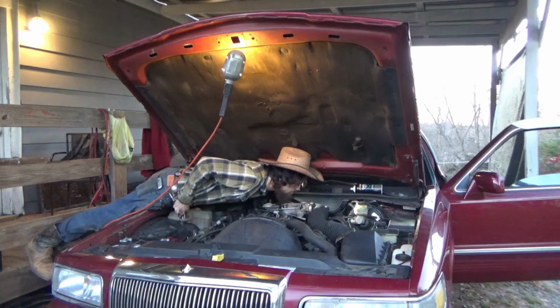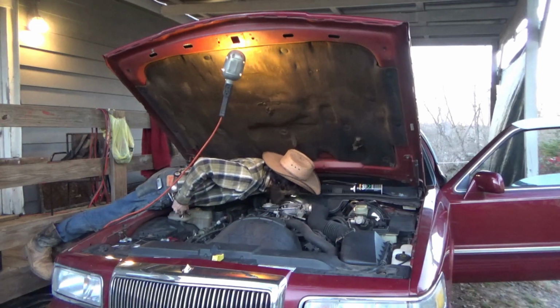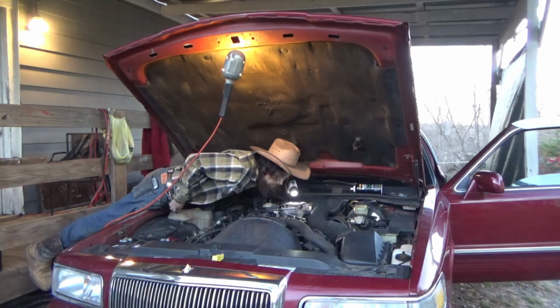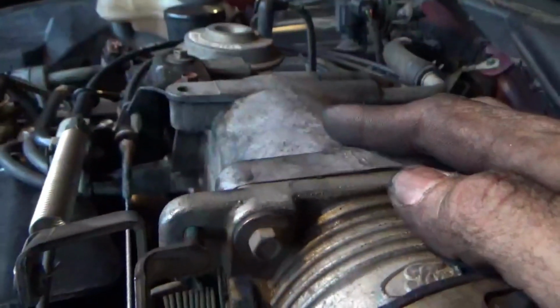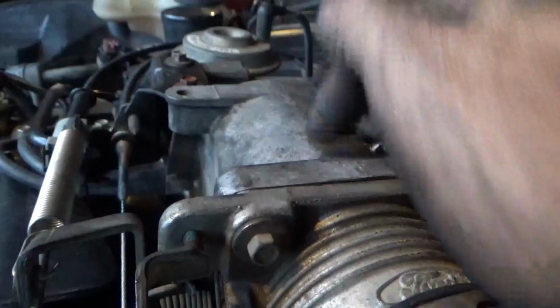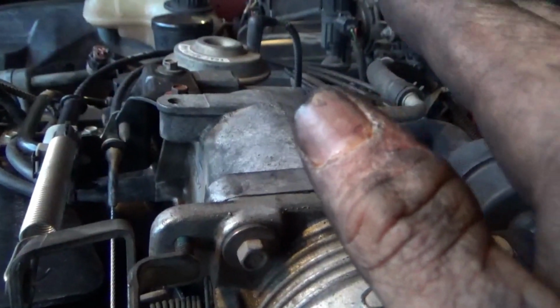It had an intake leak. I can hear it. I just gotta find it now. Damn it. Well, can't always win. It's definitely got an intake leak, and it sounds like it's coming from up in this area. So what I'll probably do is pull my throttle body and everything off here. Make sure everything's sealed off. New gasketry and some RTV around it, and light coats just to make sure it's good and bonded. And then we will check this again.